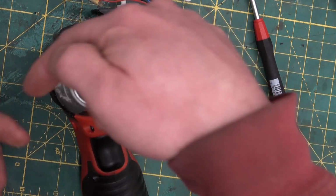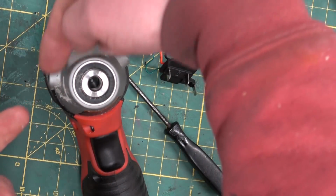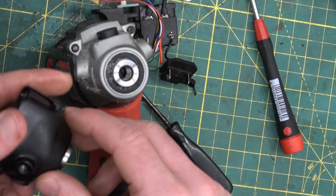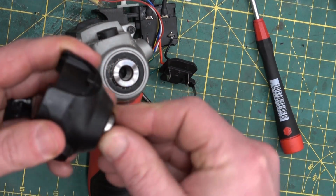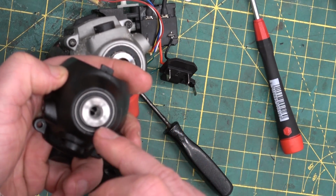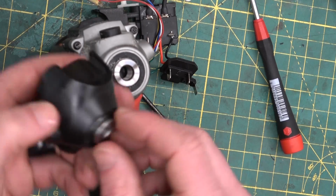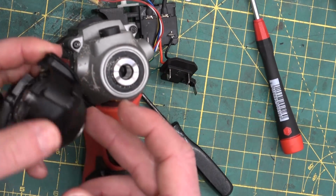Of course, bearings are point loads. You have those balls in there, so you've got to use them in pairs. You can't locate something on just a point load on a shaft, because it'll weeble wobble all over the place. And of course, the further out that you go, the more stable it's going to be, because there is inherent tolerancing in the bearing itself that allows it to weeble wobble. So this bearing is quite a bit smaller, and very likely half the load capacity. It'd be interesting to see the bill of materials cost for these bearings.